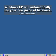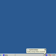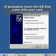When your computer boots up and your desktop appears, Windows XP will automatically see your new piece of hardware. A pop-up balloon will appear in the system tray in the bottom right-hand corner of your screen, stating that your machine has found new hardware. If asked, insert the CD that came with your PCMCIA card. The CD will run through, installing the relevant software.